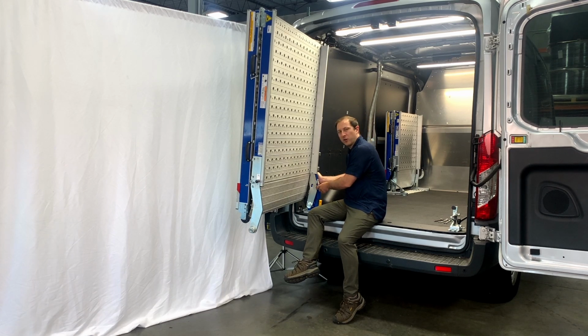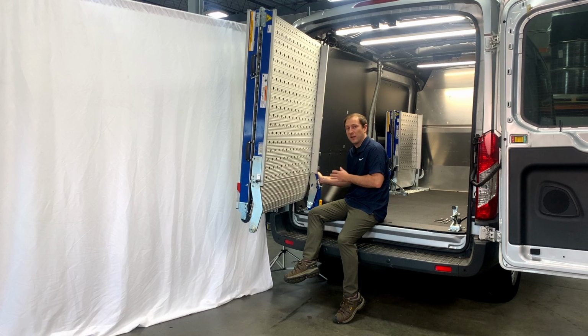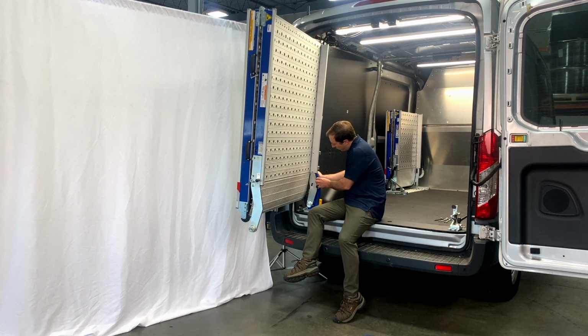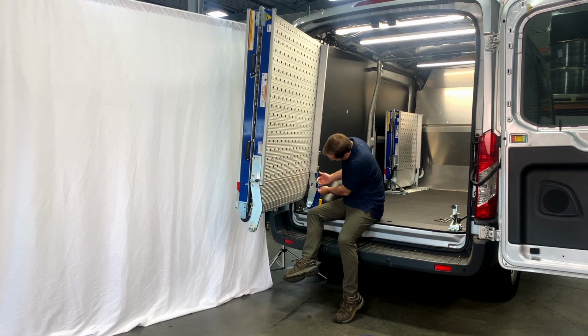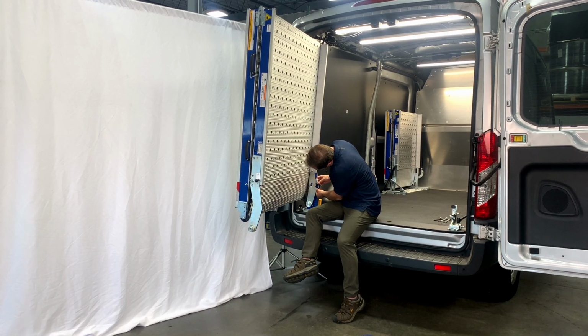You'll notice the powder coat can be a little sticky, and this doesn't need to make positive contact. In fact, you don't want it to make positive contact. You want it to be just below this stud. So go ahead and play with your threads here a little bit. Get it to equalize. And when you think you've got it good, and it's going to move freely, but be just below the stud, I want mine to lift a little.